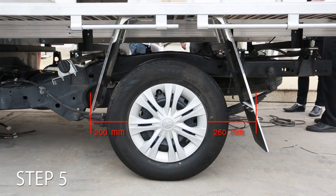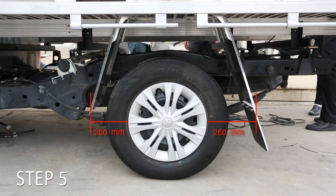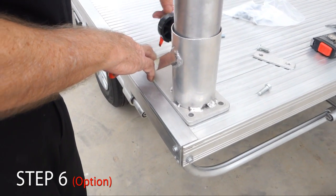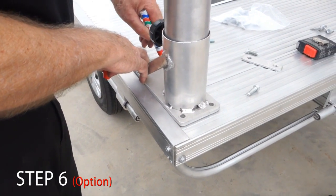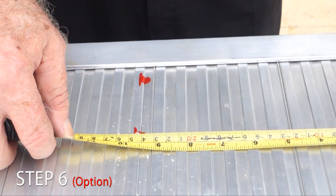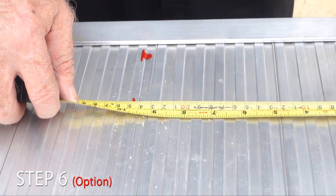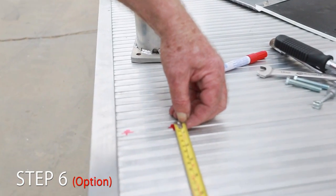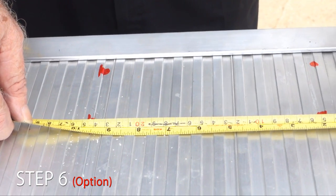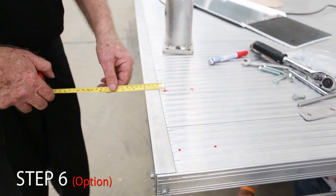And I gave Mr. A a 6.5 millimetre drill, and I said they should all be 6.5. Okay, for the positioning of the rear ladder rack mounting bracket plate, we need to drill 2 holes. So we drill 2 holes, 245 millimetres from the rear combing. We use the spacing here to determine the space apart.